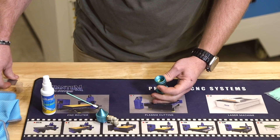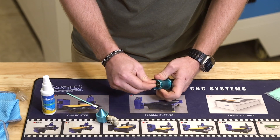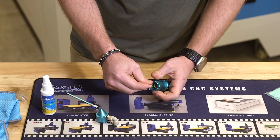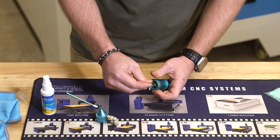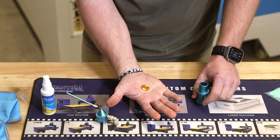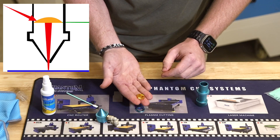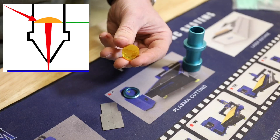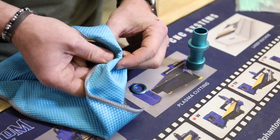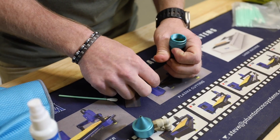Now that the head and tube are separated, remove the lens from the head by placing the flat metal lens removal tool in the head and engaging the two slots to unscrew the retaining washer. Before taking the lens out, make sure to keep it oriented correctly — the dome side of the lens will always be up. Clean the lens just like any of the other lenses, and remember do not use paper towels. Then repeat the steps in reverse to reassemble.